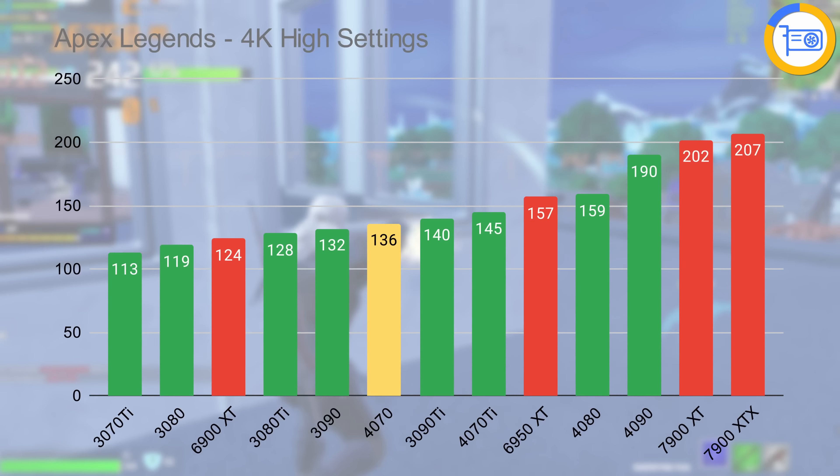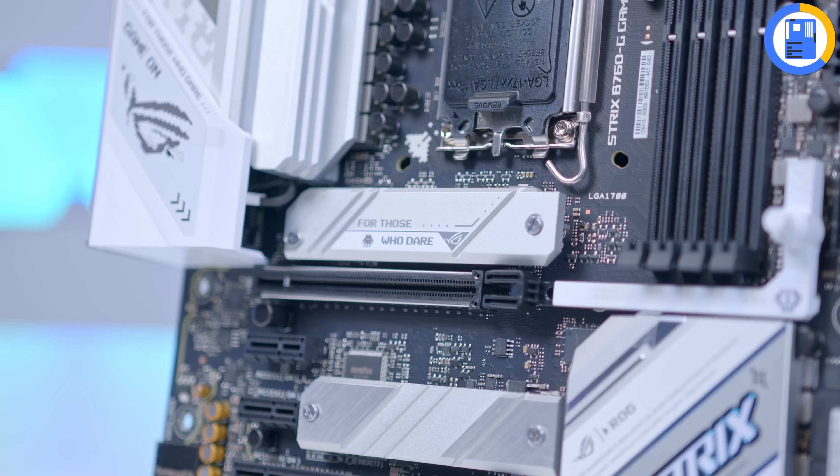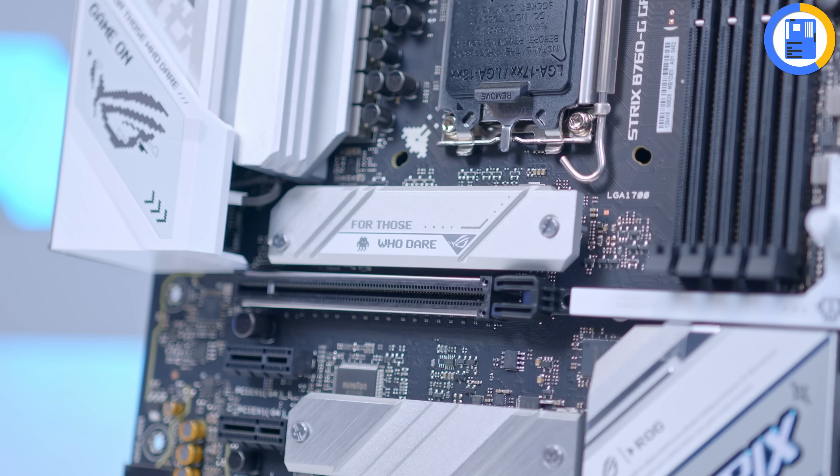It is quite a good looking card — fairly lightweight and compact in its form factor, though there's more bleeding plastic sticking to it. In terms of design and form factor it's more than adequate: you get a two-fan design hence the Asus Dual cooler name, a nice backplate on the rear, and a single 8-pin power connector. There's no ATX 3 PCIe Gen 5 style connection, but that's fine as it doesn't take up much power and only needs one cable — probably a cost saving that removes the need for an adapter.